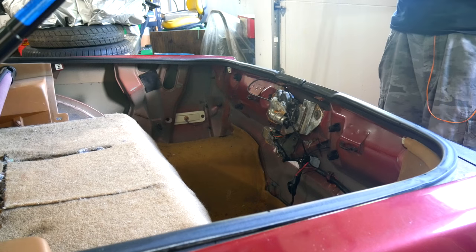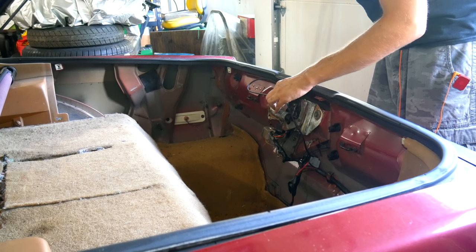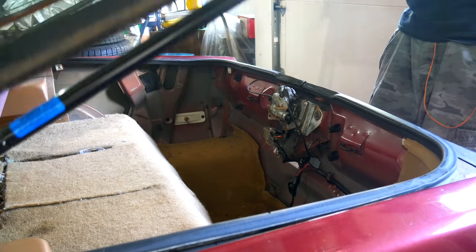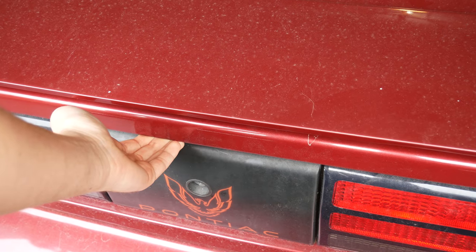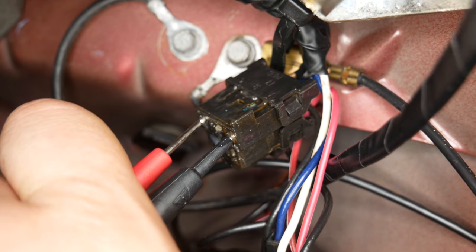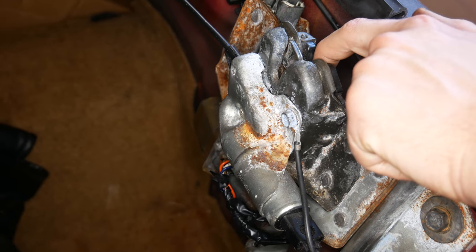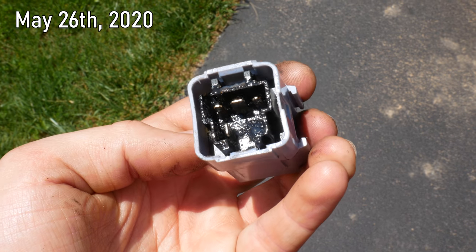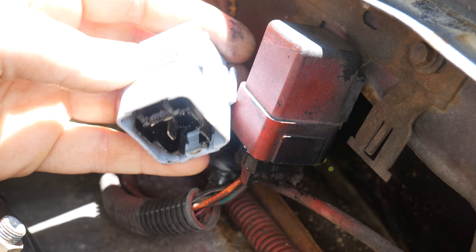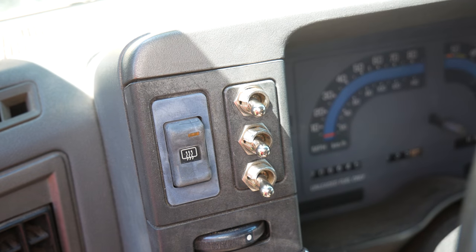After replacing those guides, once again that function is not working - but annoyingly, when the wires were wiggled it did start to work. At this point since things mostly worked I decided to just leave it alone. It was quite a while - in fact almost two years - before I got back to it. It wasn't until I figured out the function of the relay that everything clicked, and I realized that the hatch functioned the same whether or not the relay was installed. I used a multimeter to test the wiring and it seemed okay, so fingers were starting to point in the direction of our new replacement relay. Remember that this relay is the same one used by our S10 Blazer for its fuel pump.